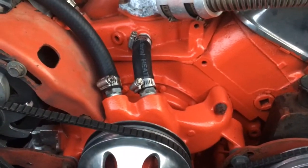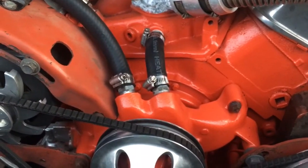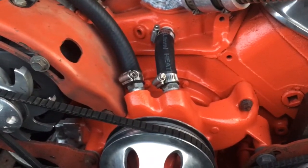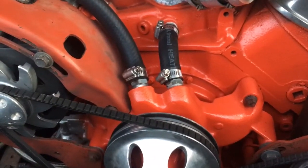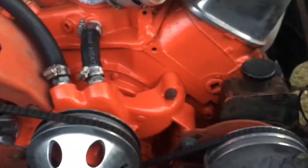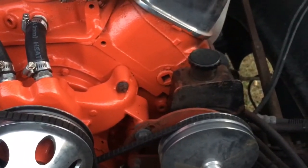What this video is concerning is the correct coolant flow from the engine to the heater core. I had the water pump off recently because I had a leak between the water pump and the engine block. A lot of those paper gaskets have a tendency of squishing out behind the water pump and the block, and they leak. I put a set of composite gaskets from Summit Racing, which are much better — they didn't really squish out at all; you can't even see the gasket. They have a steel backing with gasket material on either side.